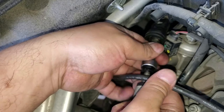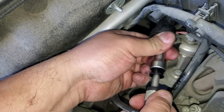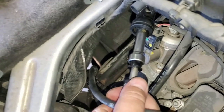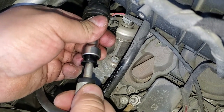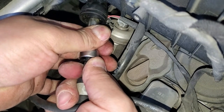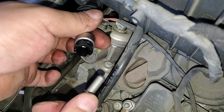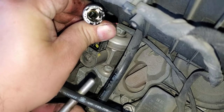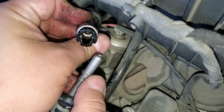I located the source of this leak at this connection — there's always a little o-ring in that connection. We're going to push in on the line as I did right there. So simultaneously push in on the line and also push in on that black plastic, and while pushing the black plastic you want to pull on the hard metal line. Now looking into the female end here, you can see there is a rubber o-ring up inside there.